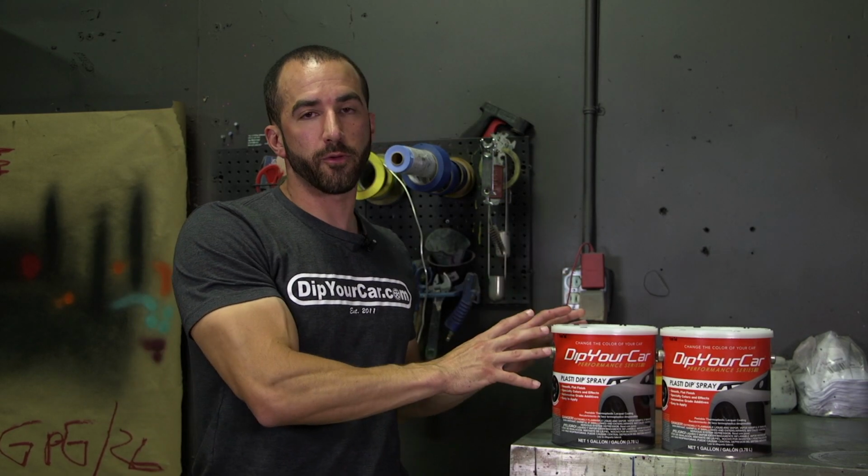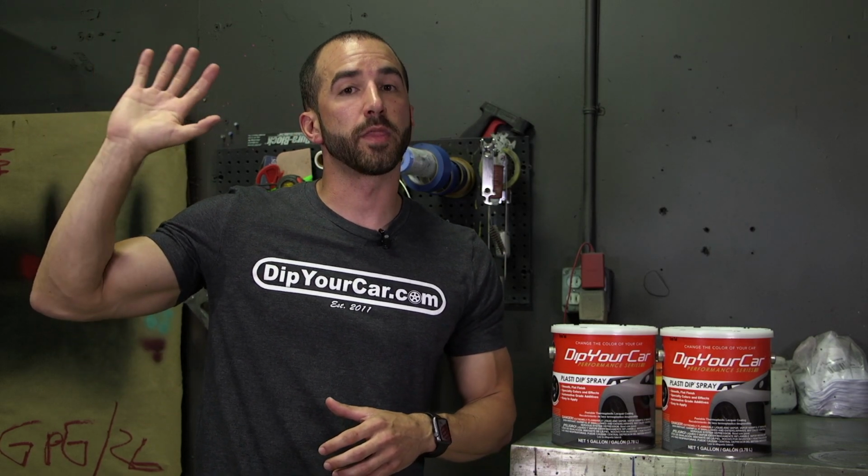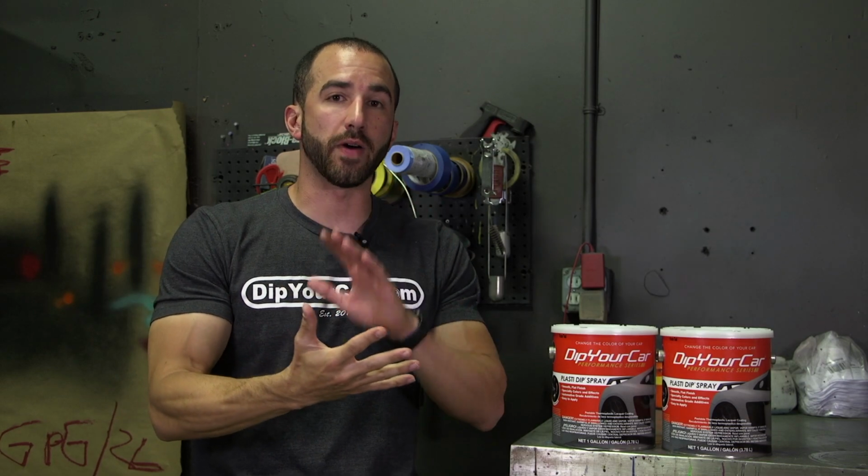So how are Performance Series gallons faster? Let's take a look at a large deep sea blue car kit. Large car kits are our most popular size, so we'll use that as an example. A large deep sea blue car kit for pearls and top coat is going to come with 5 gallons of Plasti Dip spray as your base and 3 gallons of dip pearl top coat and pearls. The reason is you're going to get all of your peelability and durability out of your Plasti Dip spray gallons, and the top coat and pearls is simply cosmetic. It goes on top. 8 gallons is going to go down on that large sedan.